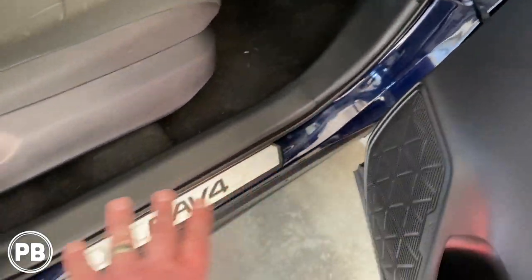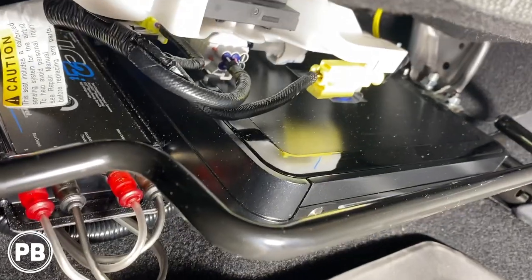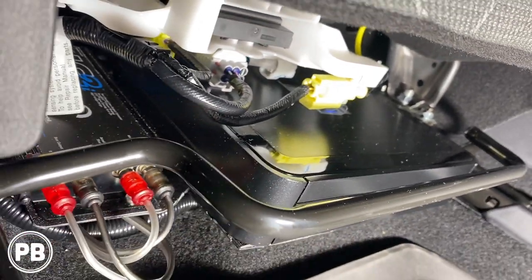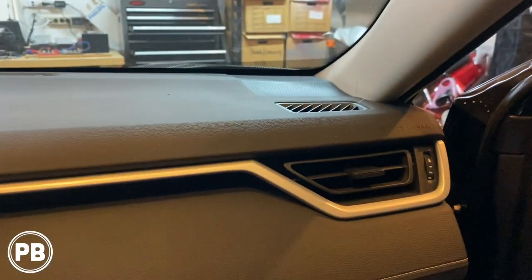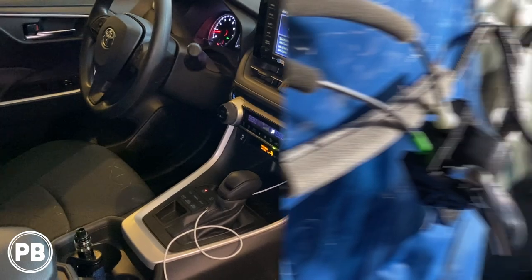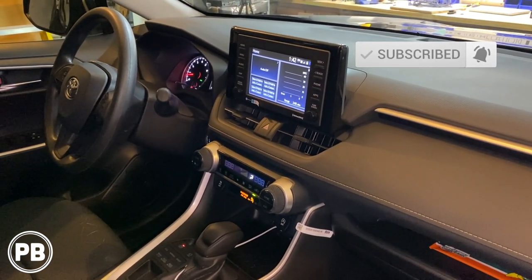We started putting the panels back on and cleaning everything up. The radio is clipped back into place with all four 10-millimeter bolts back in. The amp underneath the seat is all tucked away — it does not touch the seat at all. The LC2i is tucked right next to it. With the seat back, you won't even see it and you can't kick it with your feet — it's a perfect fit. Everything's been tuned and tested, and we set our gains with the SMD DD1. We've got the sub in the back. For links to the subwoofer and door speaker installs, check the description. If you have any questions, post a comment below — thanks for watching, hit the like button, and don't forget to subscribe!